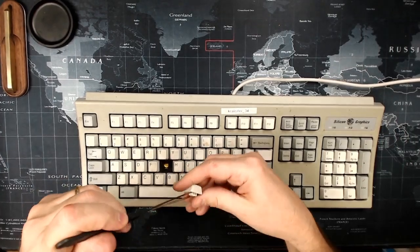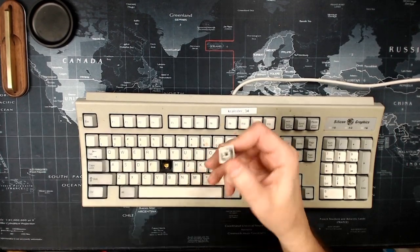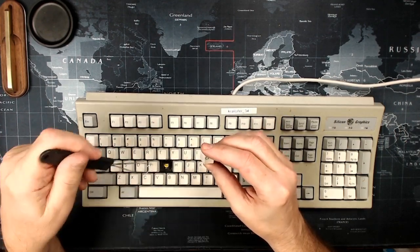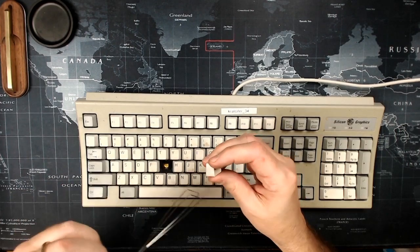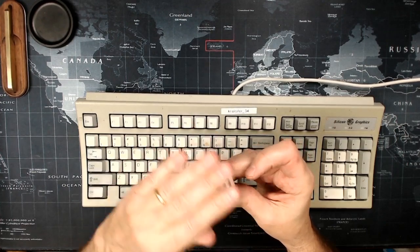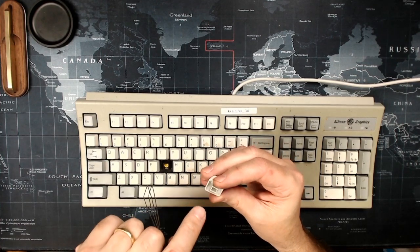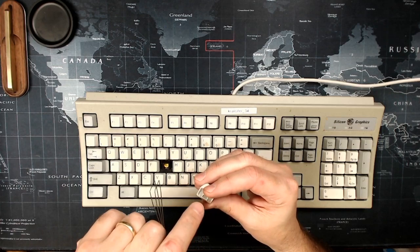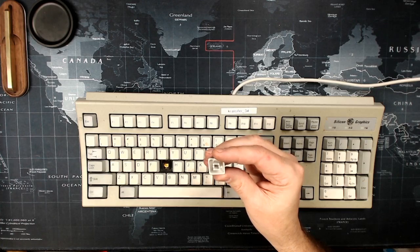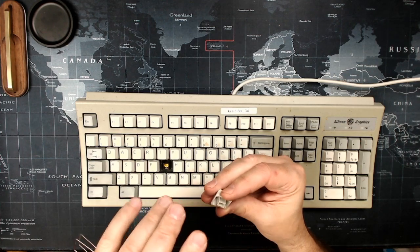Again, this is a crappy rubber dome with long stem built into the keycap. I do have more ideas. I'm thinking of making just the part that goes on the keycaps, the Cherry MX stem part of this, and having it fit flush across the back so it's guaranteed to match the height. Part of it goes inside, then glue it down to the top of the cap with some kind of hard glue that would harden, and then it should be level and square.